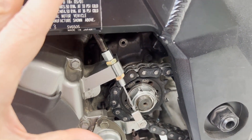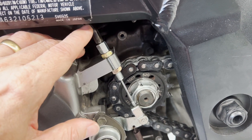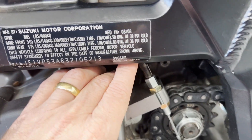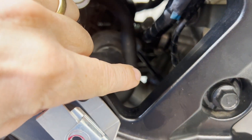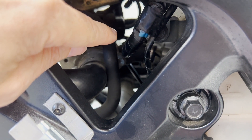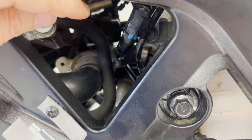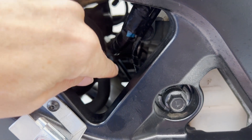What I did here is put the clutch cable in place starting from this side, because on the replacement cable the metal part is here, so it was easier to thread the flexible part through. There are a couple of options: you can either go below, as I've done here, or above the coolant lines that go between the heads. I went over initially, but that put it up too high on the frame and it started getting pinched between some other components, so I rerouted it underneath the cooling lines as you can see there.